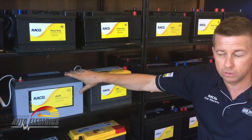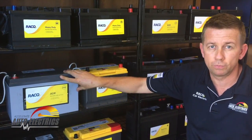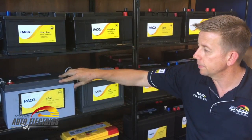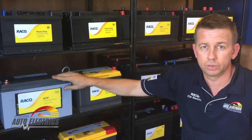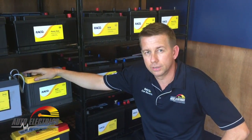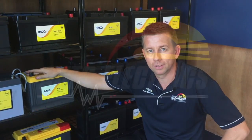You can also put it in the canopy in the rear. It's better for that slow discharge, low voltage situation. The only problem with it is it won't take heat — put it under a bonnet and they balloon up and crack the cases. So when deciding which battery you're going to purchase, it depends on its location as much as its application. Hopefully that's everything you need to know — a quick battery 101, thank you.